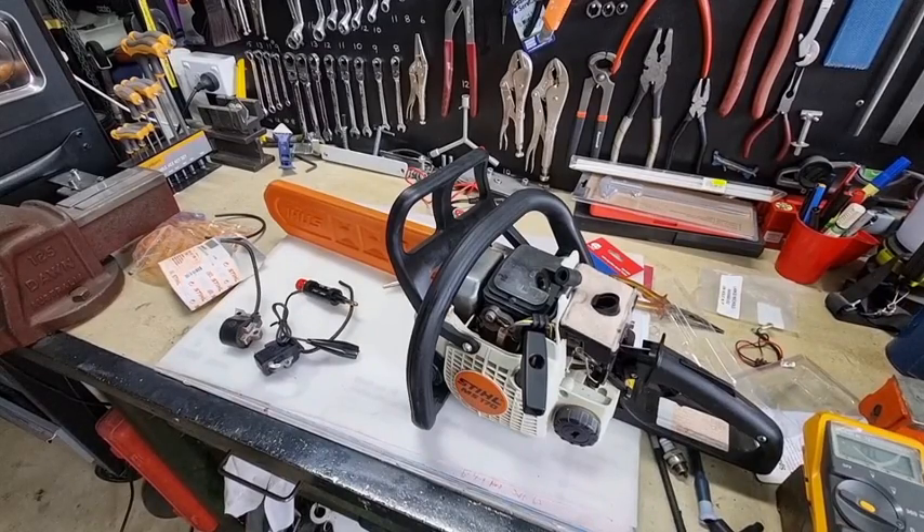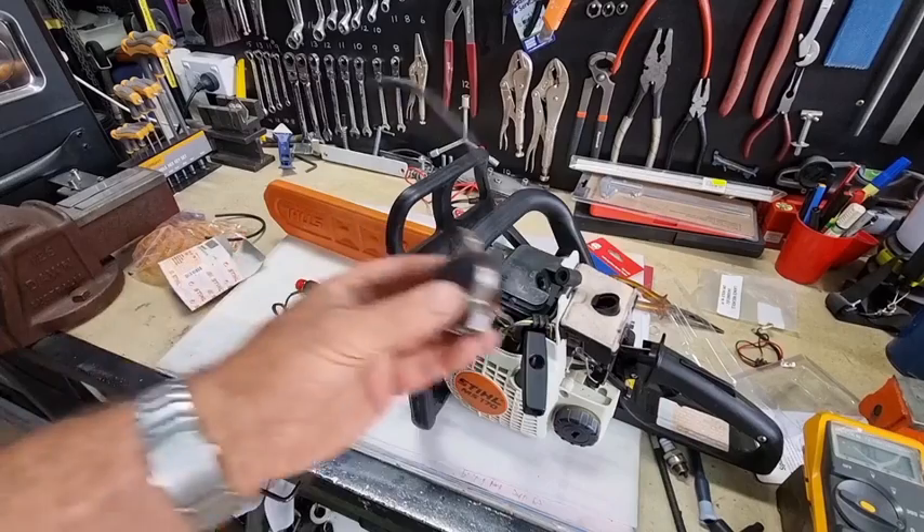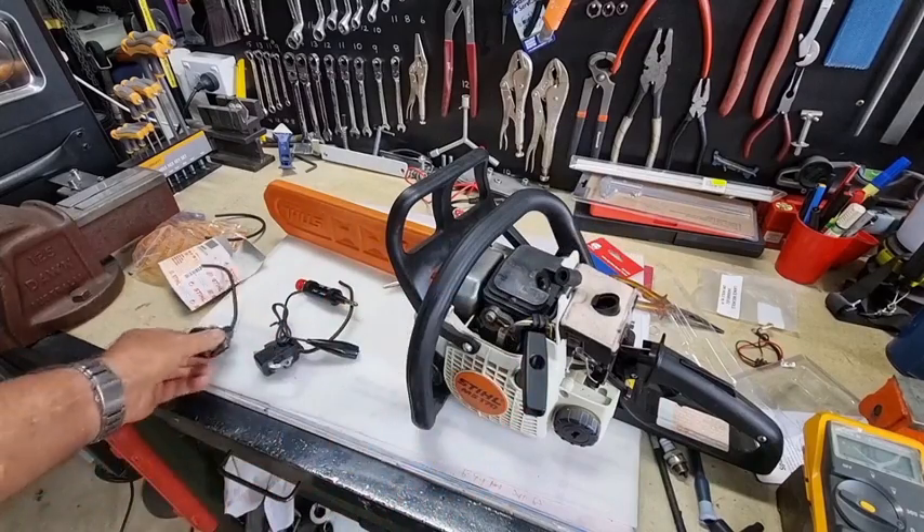If there's no spark it's not working. You don't know whether it's the primary winding shorting out, the secondary winding shorting out, or the internal electronics embedded into that coil. There's no way of knowing whether the electronics are working or partially failing. The resistance and capacitance can all change in that chip due to heat and vibration. It can break down immediately or gradually reduce to the point where it doesn't work - that's even worse. That's what happened to the MS380 - just got harder and harder to start.